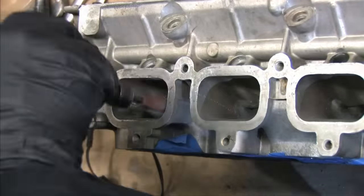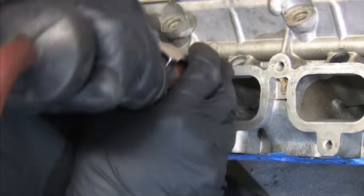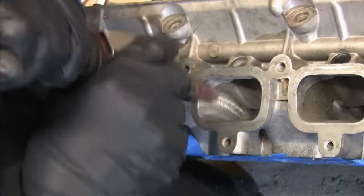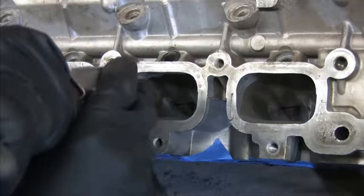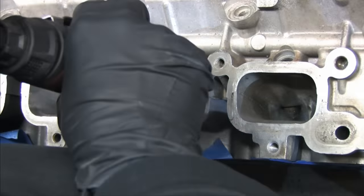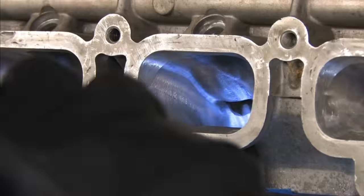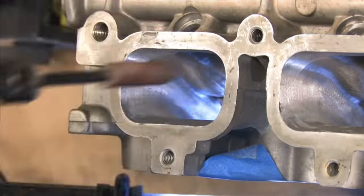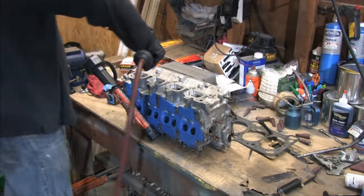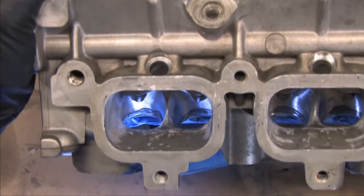It's the short radius side, the shortest distance into the combustion chamber from the intake flange. It's also what the fuel injectors are aimed at. For the walls and the roof, I sand them all completely smooth. This makes the long radius the fast radius, and the short radius the slow radius. It should, in theory, create a natural tumbling effect of airflow that doesn't negatively impact fuel atomization. It doesn't permit fuel to pool in the intake, and with three polished surfaces, it should improve the intake port velocity. Port velocity is something that this particular 1G cylinder head with oversized intake ports doesn't know a whole lot about. Here you can see better what I'm talking about.